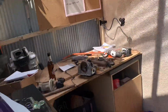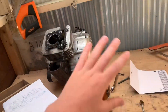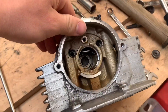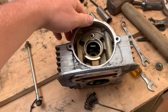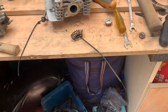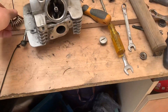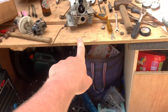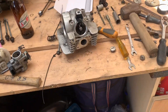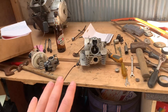I've been trying to make some videos on this — trying to do a top end teardown. The problem is I haven't been able to get the sliders out of the head, the pins that hold the rockers on. That's a bit of a bitch. I've made my own little spring compressor but I've got a proper one on the way from eBay. I can compress the spring with my thumbs, I just can't press the collets in place at the same time. It's annoying but everything's going well so far.